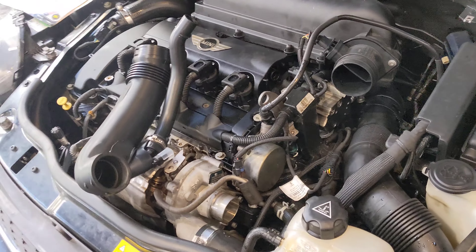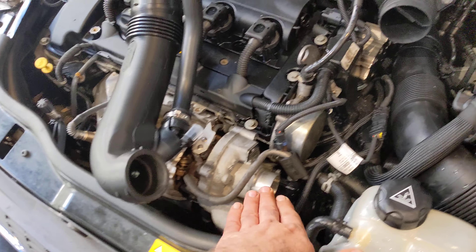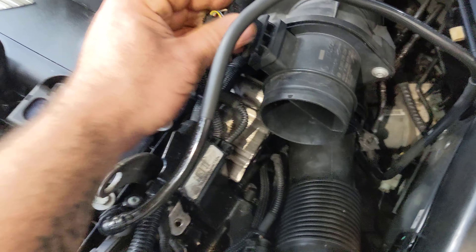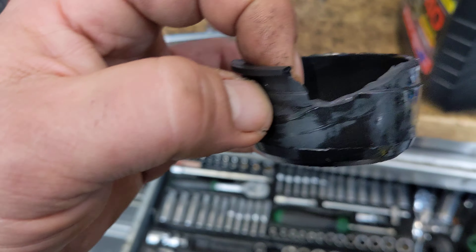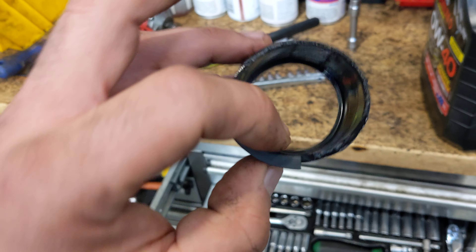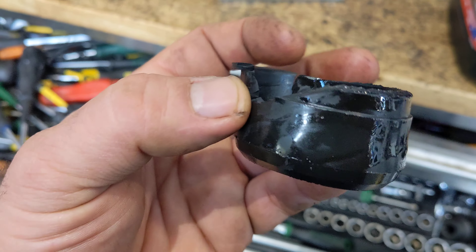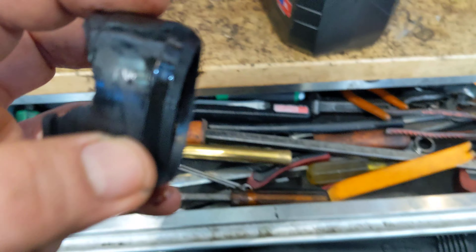So that's a big weak spot here — keep an eye out for that. If your rubber's torn, just put it on, take the rubber out, and put it on so you can move your car, and then you can clear the airflow meter codes later. Don't run the car with that rubber disintegrating in pieces like this. We cut that off, otherwise it was going to ingest into the engine last week — it was the first thing I checked, then I ordered it and it just arrived. Even if you just cut it off, don't leave it like that, because amazing things happen with boost and clamps. Things move and squash and get sucked in.